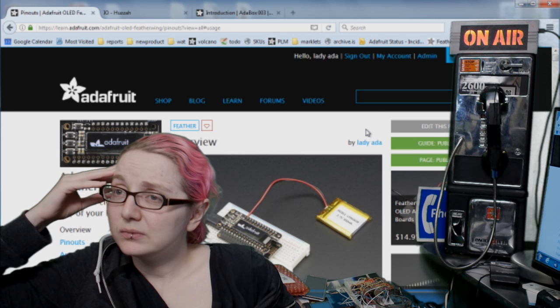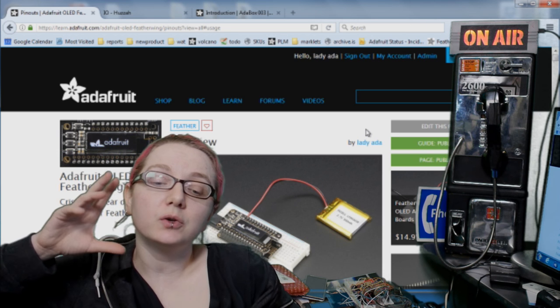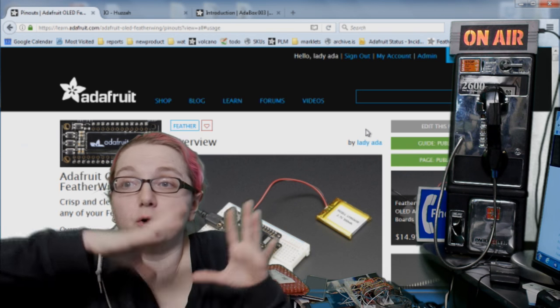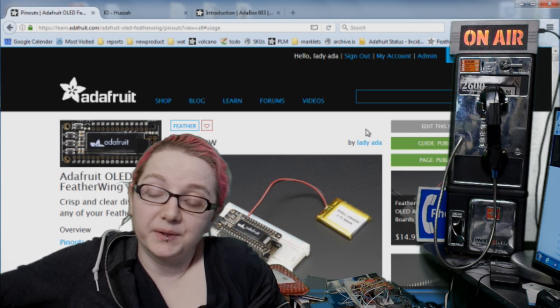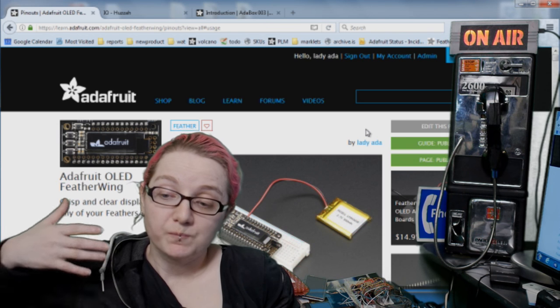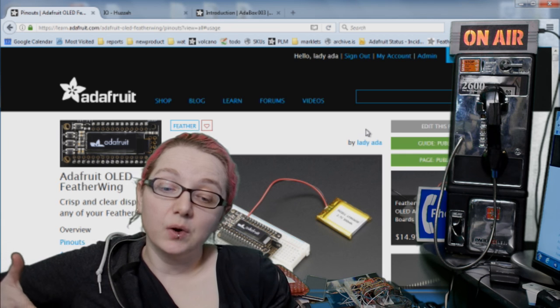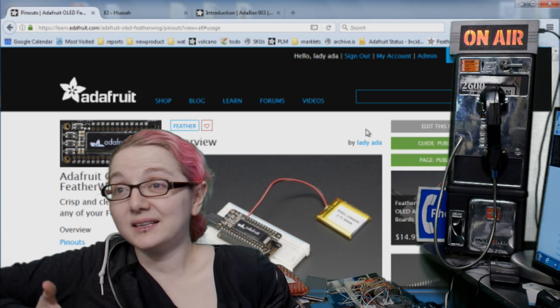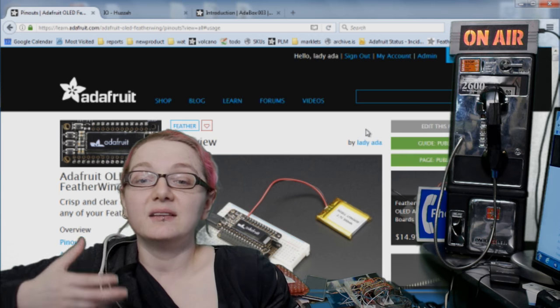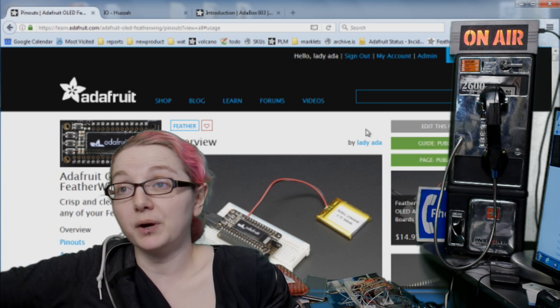Can I spin my own copy of Adafruit IO on my own server? No, you can't run your own version of Adafruit IO, the full graphing system. It's pretty complicated. However, you can always run your own MQTT server. We even have guides on how to do that. If you go to Mosquitto on a Raspberry Pi, you can basically run all of the tutorials, and instead of talking to the Adafruit MQTT server, you talk to your own private MQTT server.